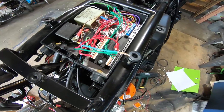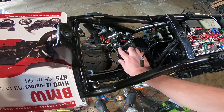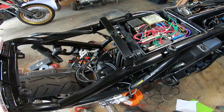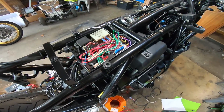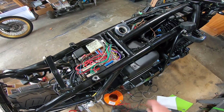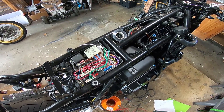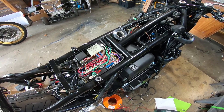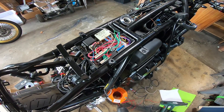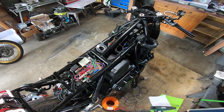We've just connected our battery negative and battery positive. These cables are still too long — we're going to shorten them at a later date. We've got a key switch in, it's just hanging here. I think we're at the point where we can turn it on, turn the engine over, see if we can get rid of the low oil pressure warning light before we plug any other electrics in and give it spark and fuel.